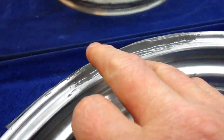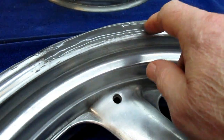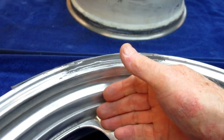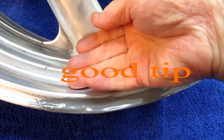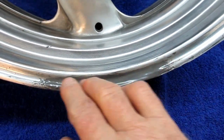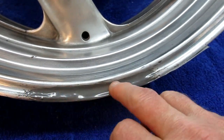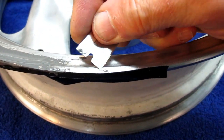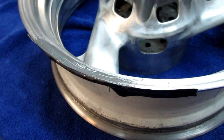I had this drying under the heating vent. As most people know, anything two-part where you mix part A and part B - heat accelerates it, so I thought that would get the cure going. What I had to do was pretty tricky. I came down after putting the JB weld on and saw that it had all started walking its way down. So I flipped it this way. It started going this way, and when it finally hardened I see a lot of it went out by the lip - I'll have a lot to sand and trim there. I call that babysitting. I just want to do my little test to see how hard the JB weld is - like a rock already. That should sand out without any problem.